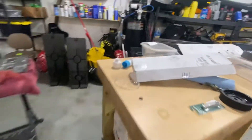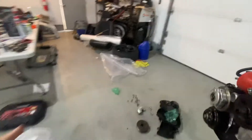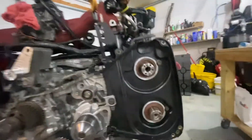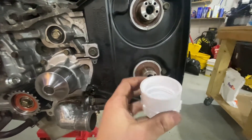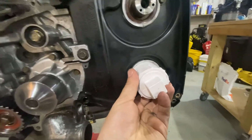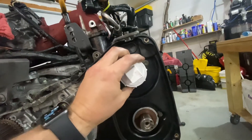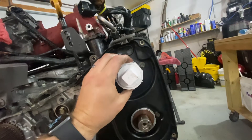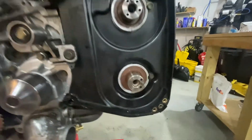Since I'm alone, I'm doing the timing belt again. For cam seals, there are tools to press them in, or you can go to a hardware store — go to the plumbing section, bring your old seals in, get some plastic plumbing pipe, and you can press it in that way. And that's about it.